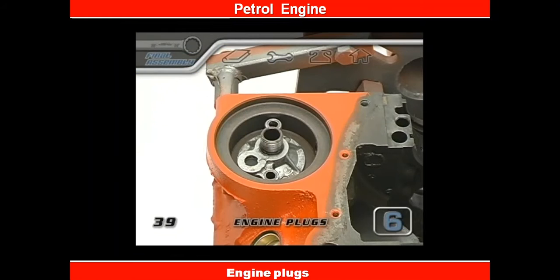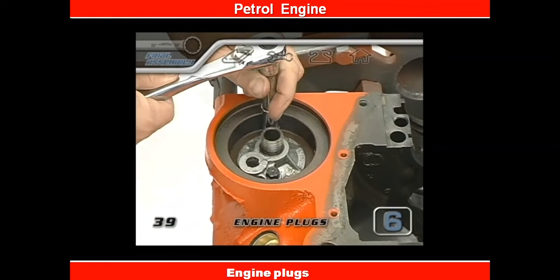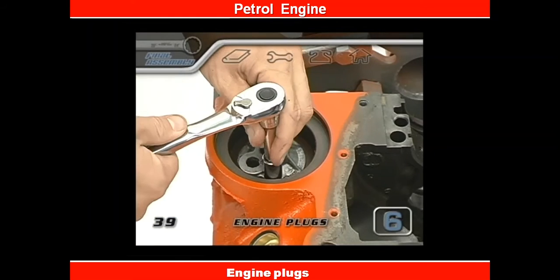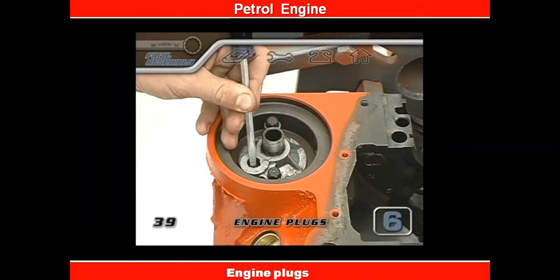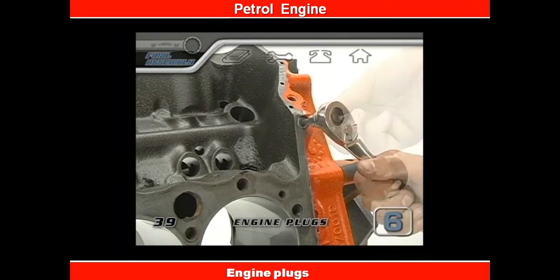Another example is the different types of oil filter mounts and bypass valves. If your motor has a spring-loaded oil filter bypass valve, check to make sure that valve is working and that it's closed properly. With the help of your notes, the block should be all buttoned up now.